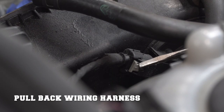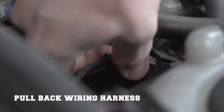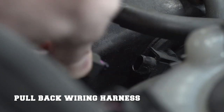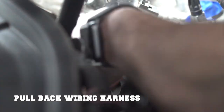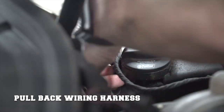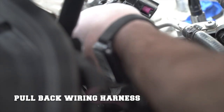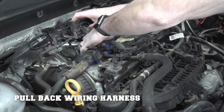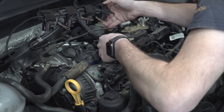While that drains, let's get the coil pack harness fully out of the way. First undo the clip on the left side by sliding out the tab, then pushing and removing. Here are the clips that a lot of people have issues getting off — I simply cut the zip tie very carefully, making sure not to cut the wire, and I'll replace that zip tie later. Once I had those clips removed and bent forward, I used a couple of zip ties to hold the harness in place and out of the way.